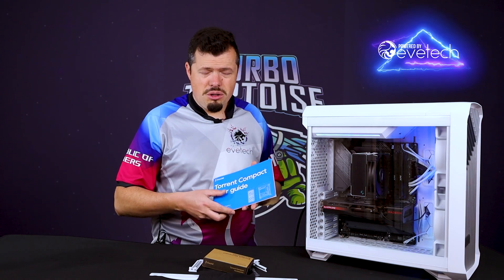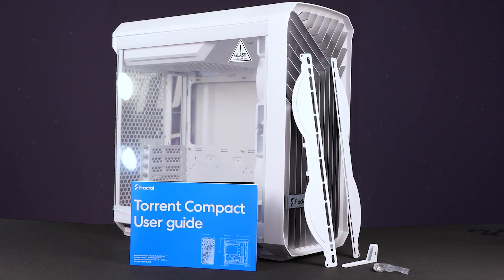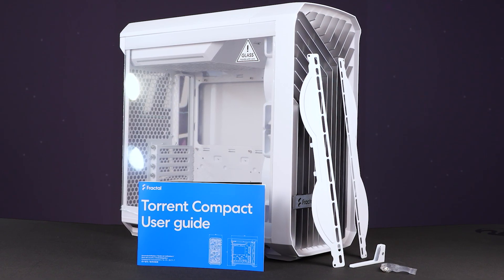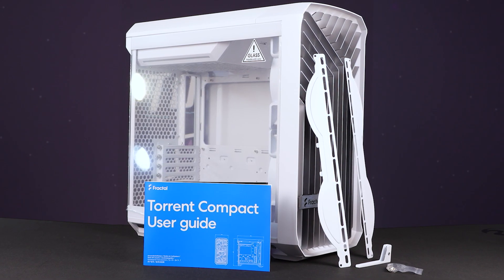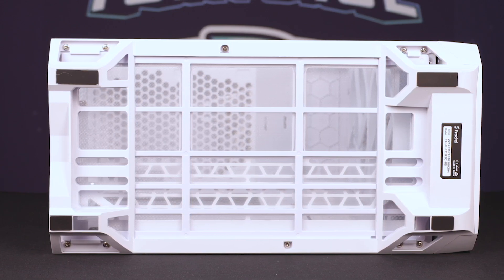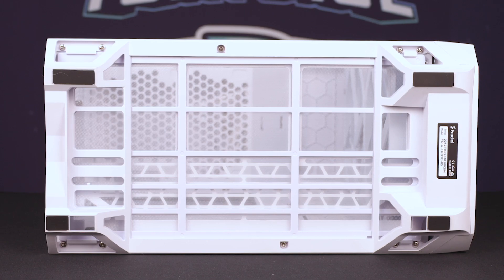One of the best and most comprehensive manuals I've ever seen — super detailed on your setups and orientations for things like water cooling. Speaking of orientation, let's talk about the case and the layout, and you'll see why this thing is so different and innovative. The bottom is actually intended for water cooling — it's completely mesh. You can see it's got a channel there for 120mm and 140mm cooling, so you could put a 280mm rad down there. Then you're supposed to channel your cables down to the bottom.